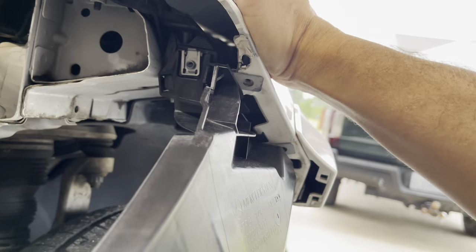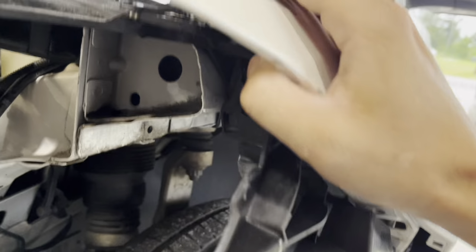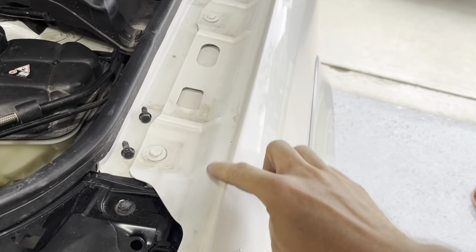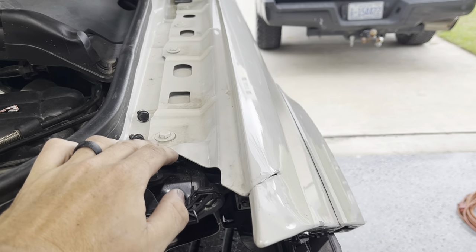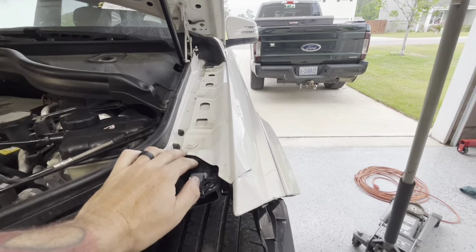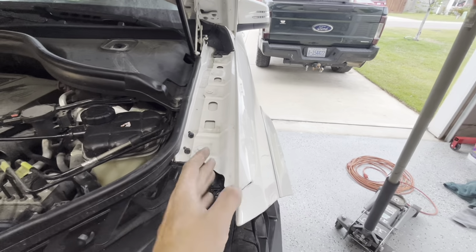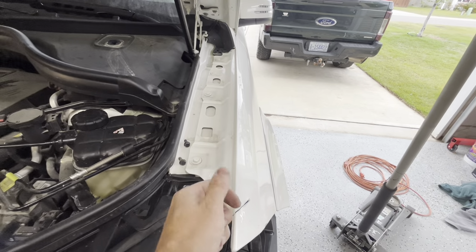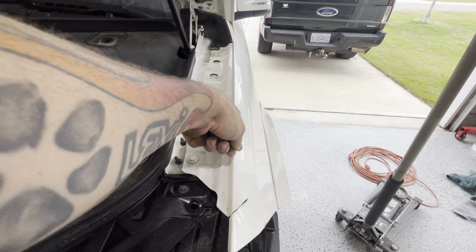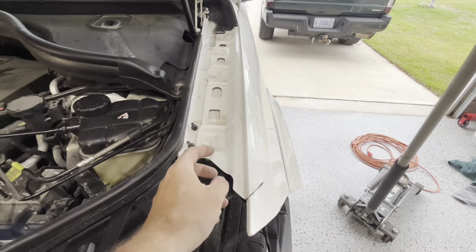So you can see it has a ton of play in these aluminum fenders. Now where the bend at is on this is, it's actually right here. It's where the bend's at. This is pretty much what we call, like, you know, blowing out the fenders, is when me and Eddie are talking at work or we get a car and, you know, we say that fender's blowed out, we'll have to straighten it back out. It's what it is, the whole fender's pulled out. So this is supposed to be standing up more. If you could grab this right here and pull this up, then it would take that in.